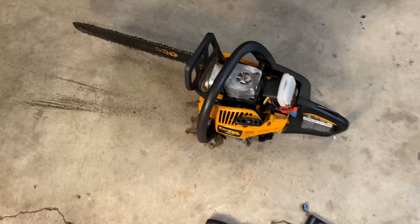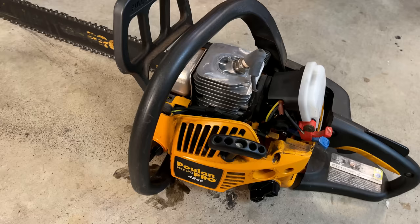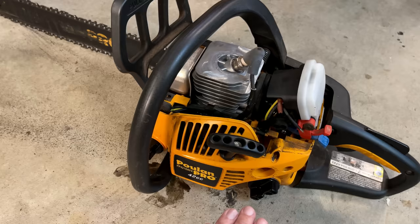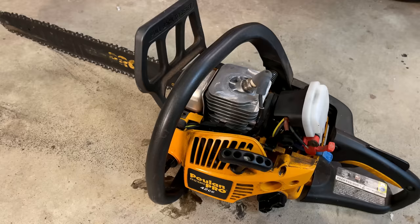Yeah, I don't know about this one, but I am making a bit of a mess. So we know the oiler is working. I guess my question is, do we have a carb issue or not? The idle speed was on the low side, so I brought it up a bit, and it seemed like it was doing better, but it is still stalling, and it was running lean. So I opened up the jet a bit more, and it sounded a lot more responsive this time when making that adjustment. So yeah, maybe, just maybe, I don't have to rebuild a carb for once.